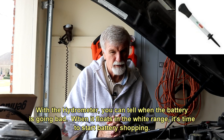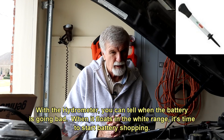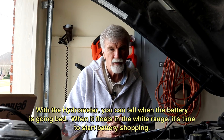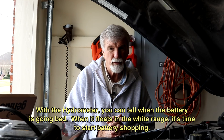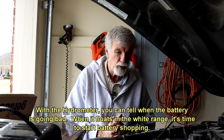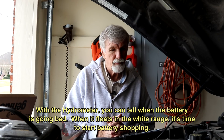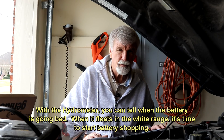The AGM is more sensitive to charging — that's the only thing about it. The old flooded lead acid battery, I'm old school — an $8 hydrometer will check that battery. As batteries get older, they lose life, they don't maintain it forever. They get weaker. The older they get, the weaker they get. You can see that on a hydrometer.